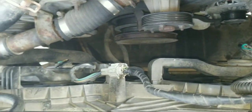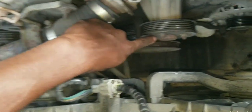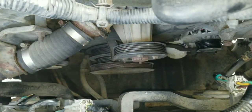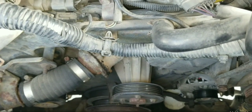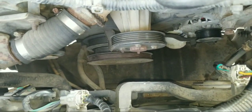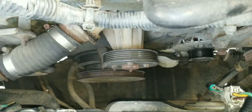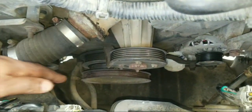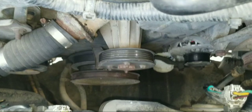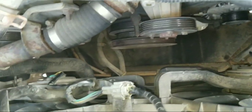This is going to be easy for us because I have electric fans on here that I converted onto the vehicle. In the video description is another how-to video for replacing the factory clutch fan mounted to the water pump — you could replace that with an electric fan. The electric fan will allow the engine to warm up much faster and free up some horsepower, increasing fuel efficiency. If you have that clutch fan and shroud you'll have to remove all that with the radiator to get to the bolt and pulley. In my case I don't have to do all of that — that's another plus for having the electric coolant fan.